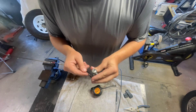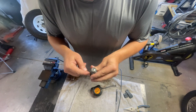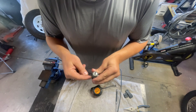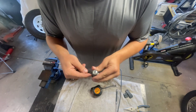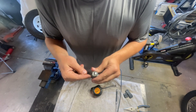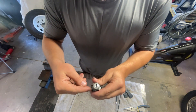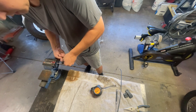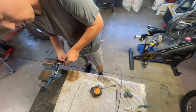From there you'll know you're in the right place if you kind of push back and you can feel a little bit of a spring action — not the spring action in the cotter pin, but an actual spring in there for this pin. Now this could be a two-person job. If you have an extra set of hands, one person presses in the pin and they pull out on that center tumbler. I don't have an extra set of hands, so I have a screwdriver over here and this vice. I'm going to get a feel for that pin, feel myself pulling it in, put it on this screwdriver.